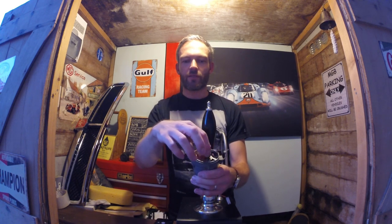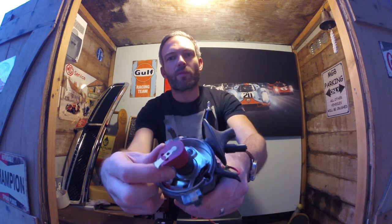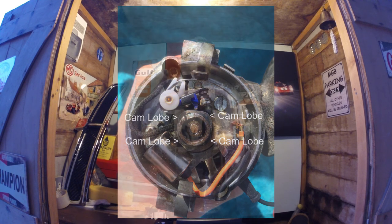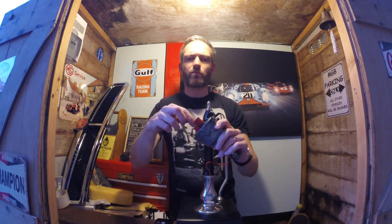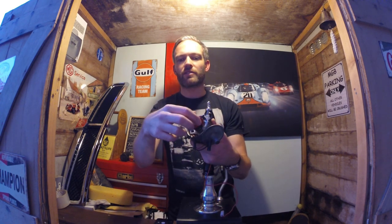So what to do about these poor components? The answer is to fit electronic ignition. This one I've got here is an extremely cheap one — it might be AccuSpark or something like that — but what it does is effectively replace the condenser and the points with an electronic module. The points were controlled by a cam on the shaft — the lumps of the cam would open and close the points — but this is now replaced with a collar that has some sort of magnetic pickup.